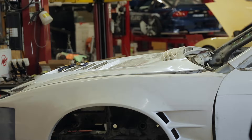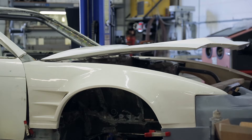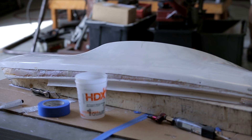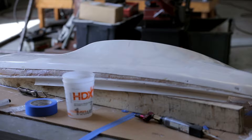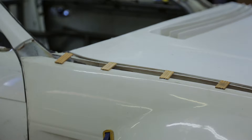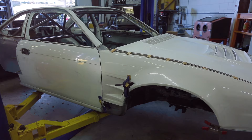What we were able to do was take a set of Origin Type 3 fenders for the S13 front that I wanted. There had to be some cutting and widening to the top parts to make it fit, because the S13 hood is a little bit narrower than the S14 hood. We had to bring the fenders in to match the width of the hood, but also go out to match the body line of the door, so we'd have a clean, OEM look to it. I ended up putting Bub through a bunch of trouble getting it to work and fit the car.